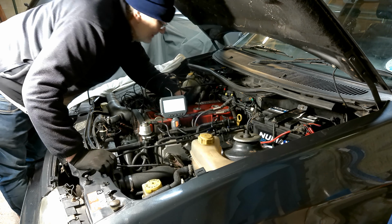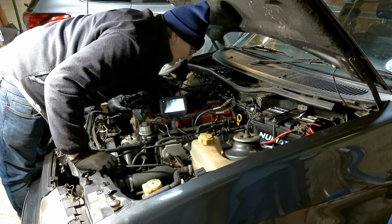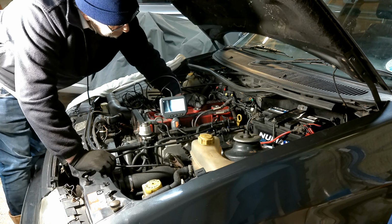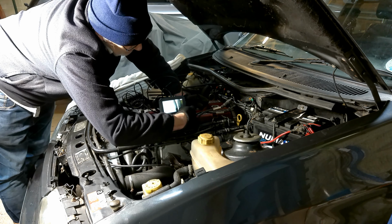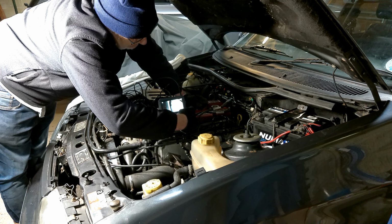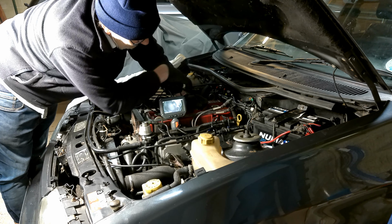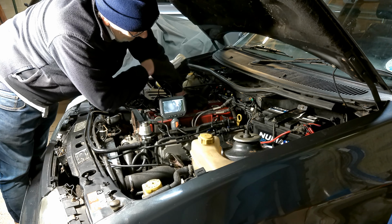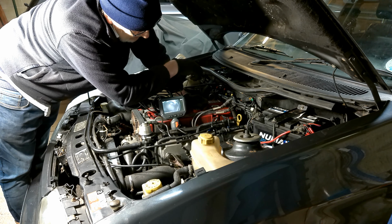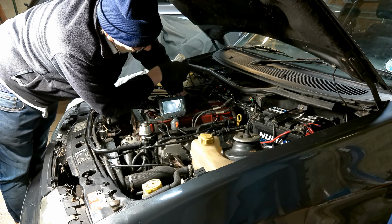Down here, this is number three piston. I'll have a quick look down in here. So see, it's looking at the valves. Let's have a look at the piston first. Okay, no, still on the valves. That piston, oh yeah, we can see a mark straight away on this one as well. So all eight valves were hitting the piston, and they actually put some nasty marks into it.